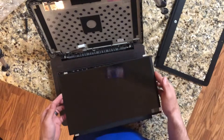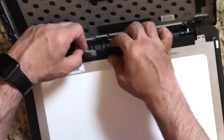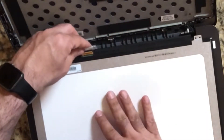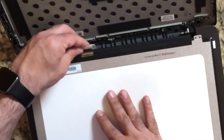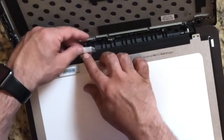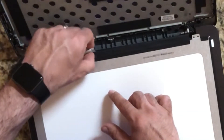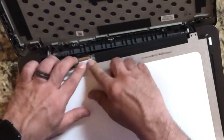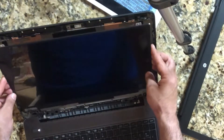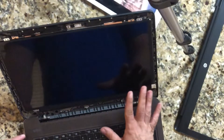Put that old LCD to the side and get your new one. I'll leave a link in the description for where I got this one. I have gotten bad ones before, so if you get one that doesn't work right away, try reconnecting it, and if that's not the case you can check if they sent you a bad screen. Connect it the same way — sometimes it takes a couple of tries to fit in right, but it's like a little lego piece: it goes in one way and one way only. Once you snap it in you'll hear it snap, then put that little frame piece down and put the tape back over it to hold it in place.